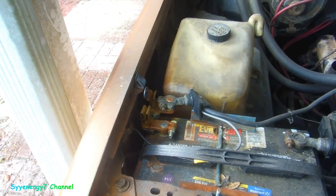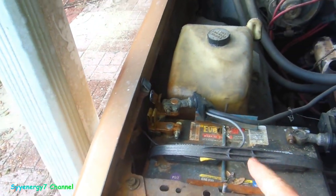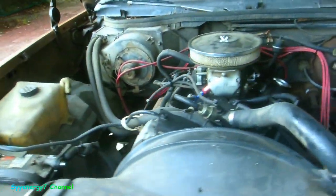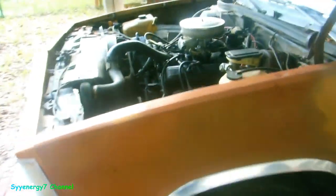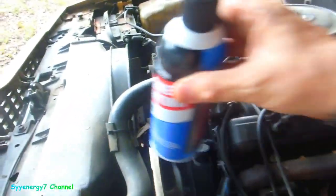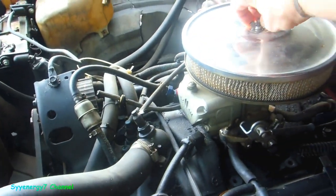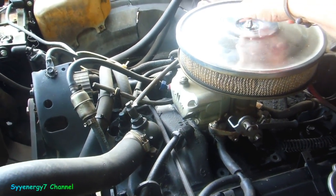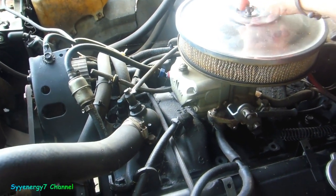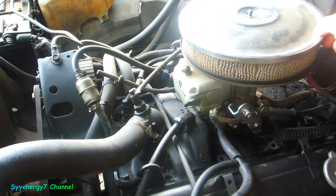This thing's gonna be a real bitch to start. One thing is the battery with this disconnect — I don't get the drawdown on it. But I want to get some starting fluid in here, and I think what's gonna happen when this thing does finally start up is the idle is gonna surge. That's due to the carburetor getting gummed up.